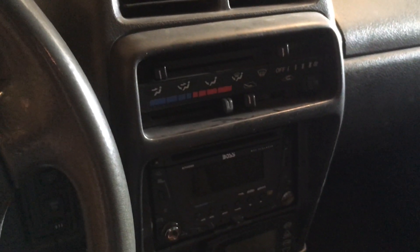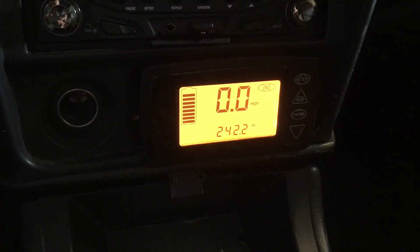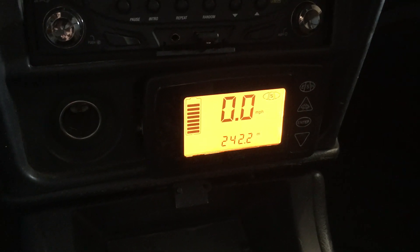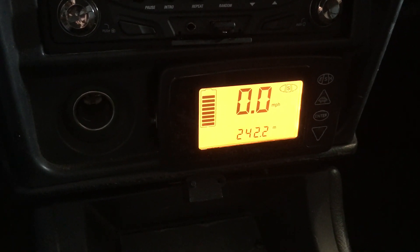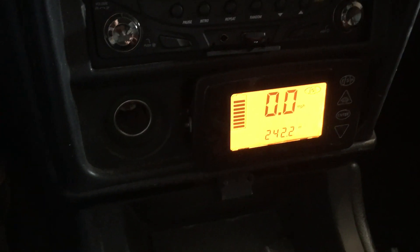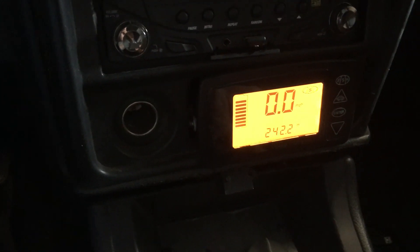The Hyper 9 IS system comes with a display — this little display right here. There's a lot of things you can program in it; it's very adaptable. I connect to it with my computer and can program all sorts of drive modes, regen settings, and even a battery capacity curve, so I get a little battery status indicator. It has speed and odometer, which are programmed based on motor RPM. Since I don't have a transmission, as long as the transfer case is in high range, motor speed is a direct indicator of road speed — there's only one gear.